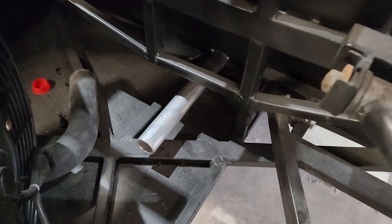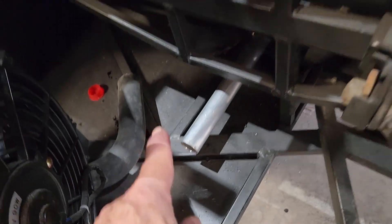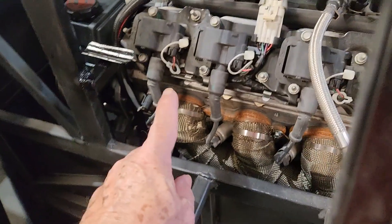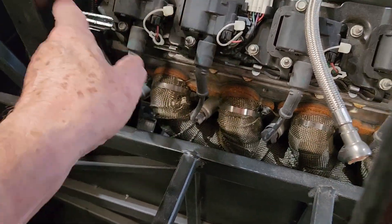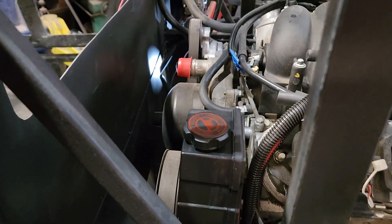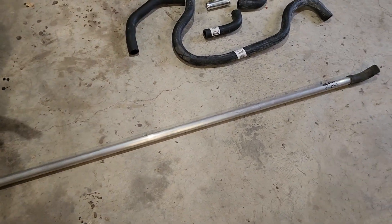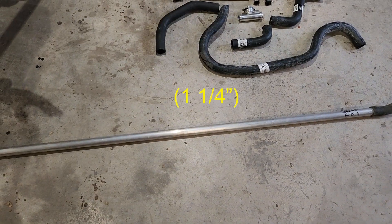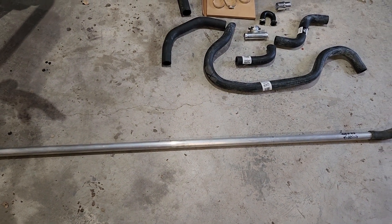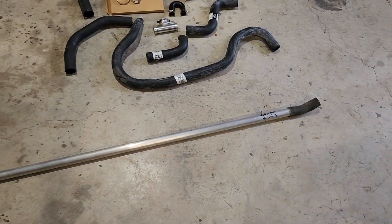It'll come out on this side and then go up here to the inlet. And then down here, that piece will come up here to a radiator fill cap that will go here, go around, and be connected over there to the return line. I bought a stick of inch and a half ID aluminum tube, but it happens to be schedule 40, which is pretty thick, and the pipe will fit on there.